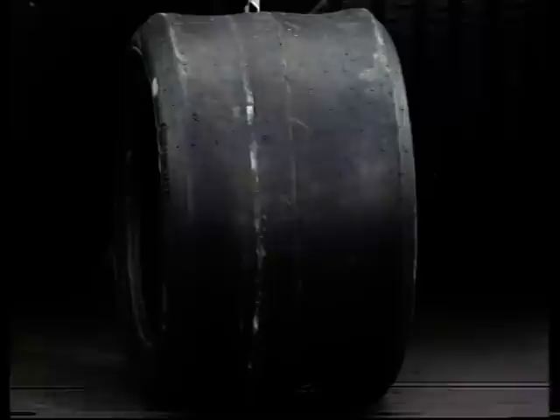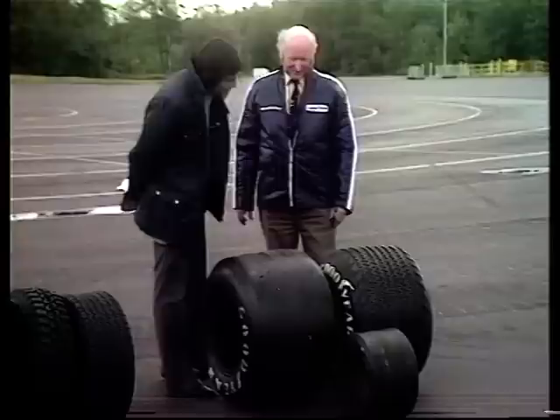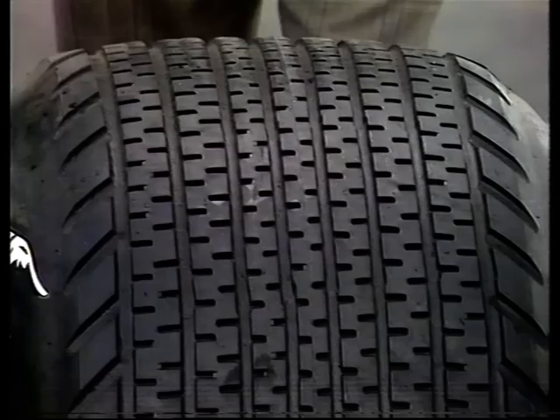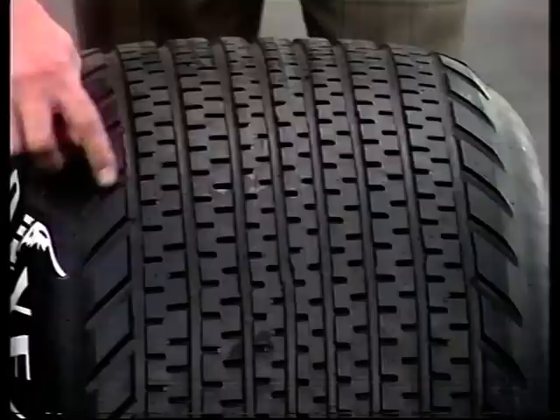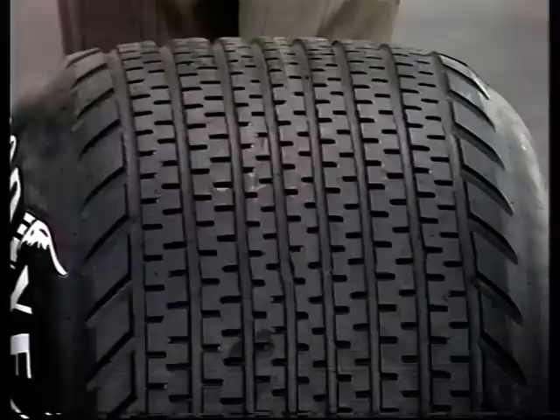What's that mini one down there? That's got to be the smallest racing tire in the world, hasn't it? It must be, yes. That's the latest development on our Formula One project, and it is for the six-wheel Tyrrell. Oh, I see. And, as you can see, it's in slick form, which they're used for on the front of the car. But if it's raining at Brands Hatch, one of those, yes? Definitely, yes. This tire is in a softer compound still, which the compound gives traction in the wet. But also the design, as you can see, these sipes for water dispersion. These are called sipes, aren't they? Yes, that's true. You get water dispersion and the compound to give traction. Your idea is to get rid of the water quickly, so that you don't spin and have a big accident.